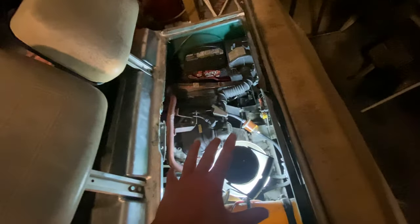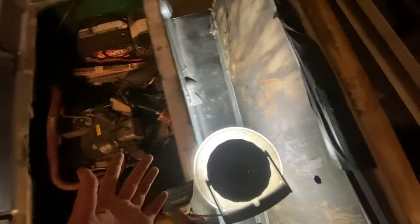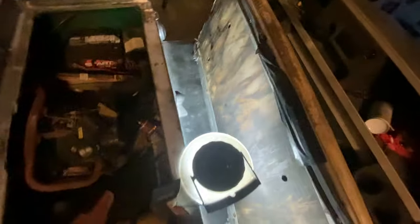Gas ones, God, there's so many things that could be doing it. Let's start off with the sound. All right, if your thing says forward right here, but it's not going forward, then it could be your ignition. So your ignition is right here. So you'll pop this thing off, and you'll see wires as the ignition. Okay. Now, what I like to do before you even mess with that is check your fuses also. It could be as simple as fuse.